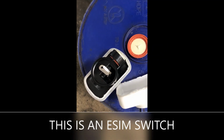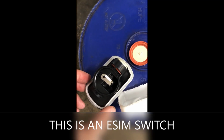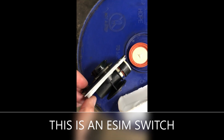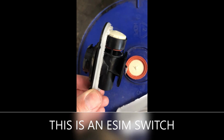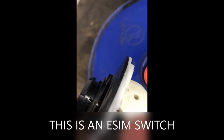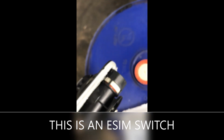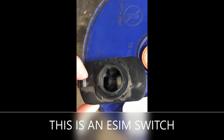Okay, so before I get into what I found, I'm going to give a really brief description of how this 2013 Dodge Avenger evap system monitors and detects small evap leaks. Any Chrysler Dodge Jeep Ram vehicle is going to use the ESIM detector on the carbon canister. It's just a little simple plunger. It's mostly a mechanical device, but there are two wires going to it. One is permanently grounded, and the other is power coming out on the sense circuit from the PCM.